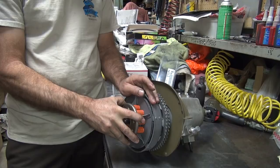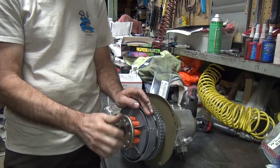So I always dial, even my bike's got that dialed into it. But as the plates wear and they get more glazed up and they get more oil onto them, I've had to tighten my tension up quite a bit. So now I'm just about totally all the way in on my bike. I got a lot of tension built into them. But you still get that slip. When I missed that shift up there, I went from 1 to 4, 1 to 3. That was a big upshift. And the clutch just kept slipping.